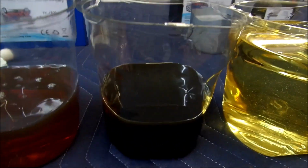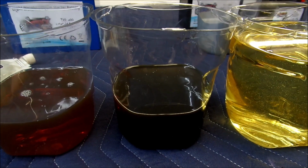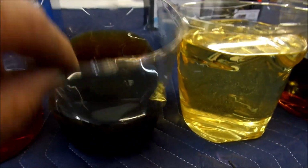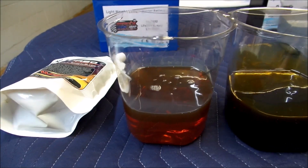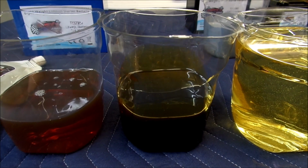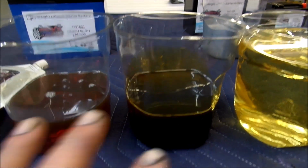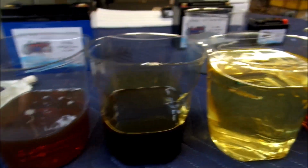This next one here is a multifaceted ingredient that is for friction alone. So there's about 14 different ingredients in this, and as you can see, it's extremely thick and viscous, and it smells really bad. So we have an extreme wear and detergent in this. We have an ingredient for friction, as well as components in there to extend the life of the oil and make it a long drain. Both of these ingredients together extend the life and reduce the oxide and the NOx effects.